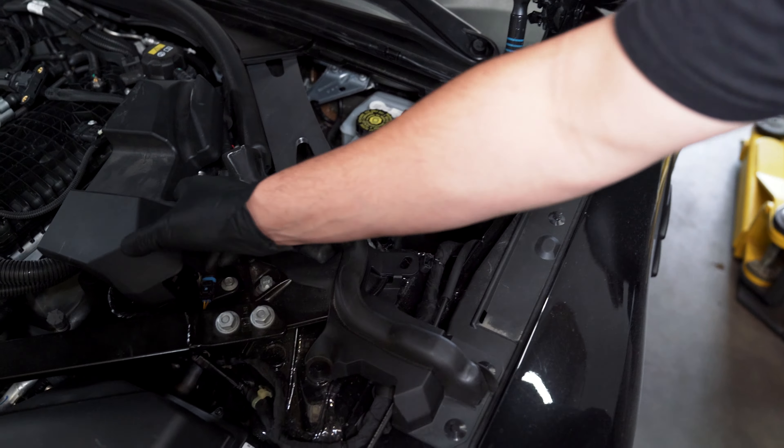Once you pay for it, it'll allow you to log in and create your sign-in info. The very first time you power the car on and open the app, they will link together — it'll ask a yes or no question to bind these two together. You can only have the JB4 linked to one account at a time, so make sure you're doing it on your phone from your own account. Once set up, you can see it's actually reading — intake air temps at 85 degrees Fahrenheit, and it shows we're on map one. Now you can see we're reading RPM, air-fuel ratios, and intake air temp is moving. Everything seems to be working as it should — we'll show you map switching here in a second.